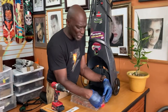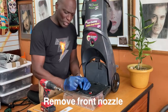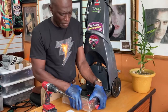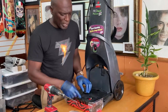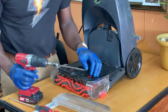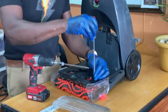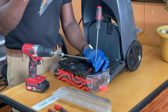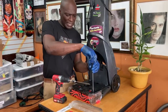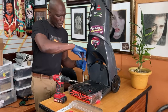You don't really need to mess with the front part, but you do have to remove your front plate. It's a small screw — this one is already out — so I'm just going to take it off, then remove this front part only because it's holding down this section. Remove all these screws here. I already loosened it up so I can use a drill, but if it's rusted, you want to get some kind of lubricant and spray your screws first, because you don't want to break the plastic.